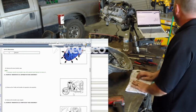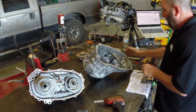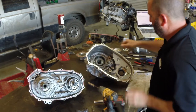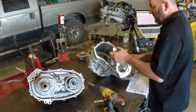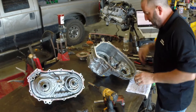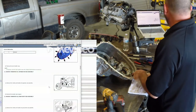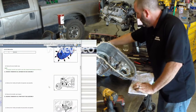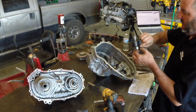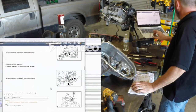Back on track — it wants the oil separator plate removed. There's a little tube here; this is a pickup for an oil pump. A lot of these Toyotas have an oil pump inside them, and it is the cutest little oil pump on the planet. There's a magnet right here in the case to pick up any metal fuzz. There's not much on this one, so that's a good sign. Next it wants to remove the oil pump.